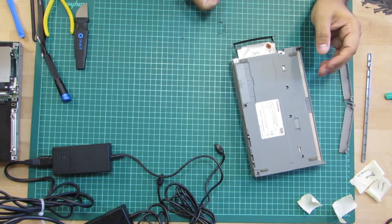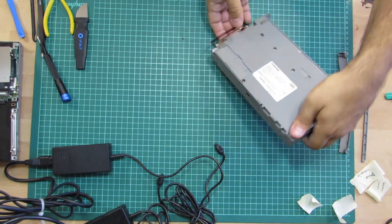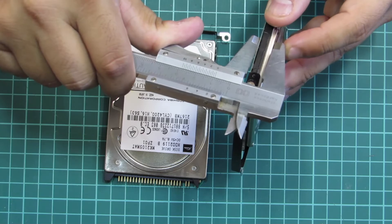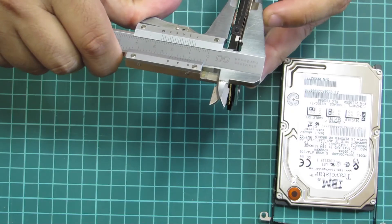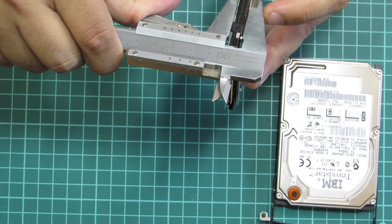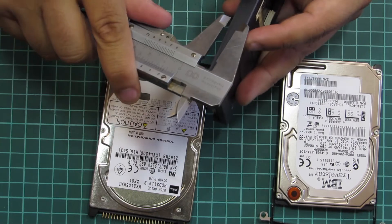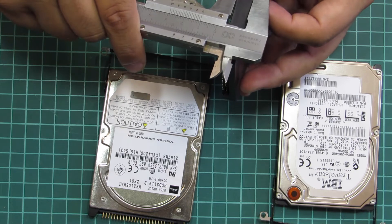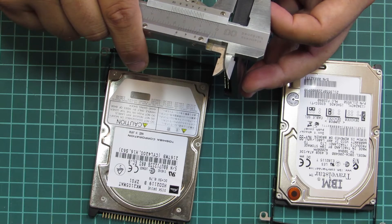But inserting the IBM drive proves quite difficult, as it barely moves into the drive slot — it's probably too thick: 9mm in comparison to the 7mm of the Toshiba drive. Even if I were to replace both drives using IDE-to-CF adapters, it's not going to work because this one even requires 10mm in height. So to replace the hard drives, I need to get something with lesser height requirements.